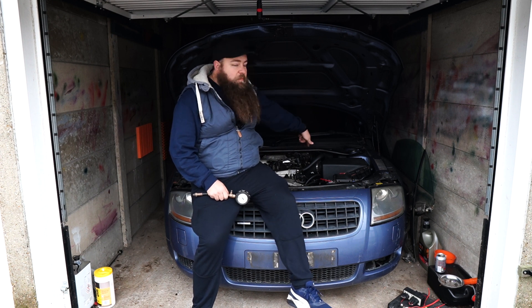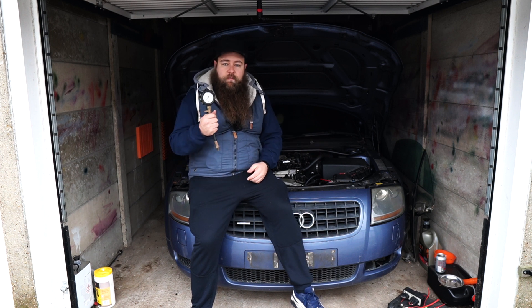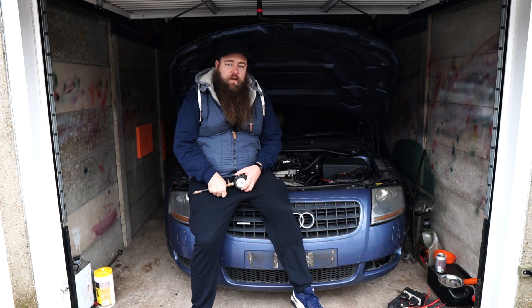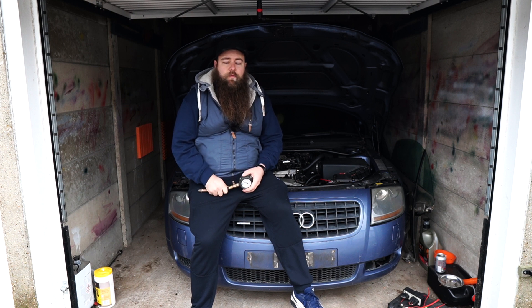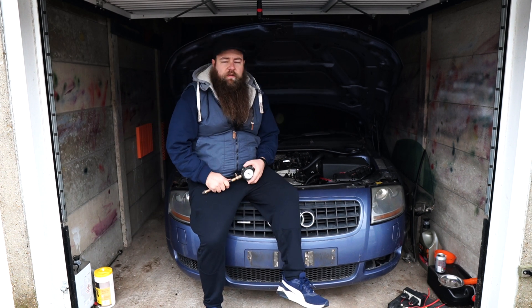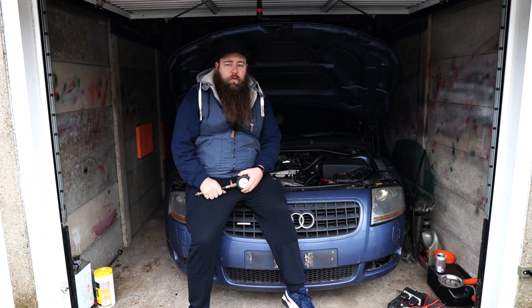There's a big orangey stain down the back of the bulkhead, and it just seems like a good idea before I spend any money on it to do the basics and give it a compression test. Hopefully all four cylinders are the same. They might be down a little bit because it's done 170-something thousand miles, so the bores might be a little oval or tarnished, but we'll hope for the best. The car is still together so we're going to do it all on film.